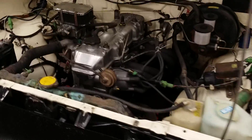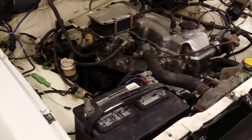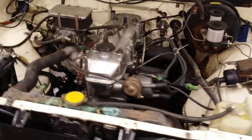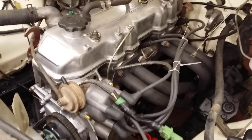For now this little sucker rolls — oh my god, it's like night and day compared to what was in there. That 20R is a tough little nasty motor too, but it was getting so weak. I was running about 50 horsepower if that — all that poor thing was putting out. This is like twice as much. I don't even want to guess what this motor's got — it's a mild performance upgrade, probably a mild cam in it. So a fresh 22R with a mild cam, Weber carb, and a header — that's what we've got going on.